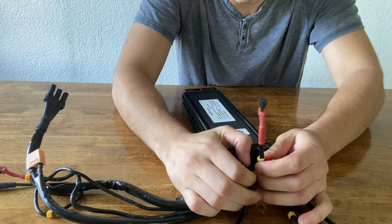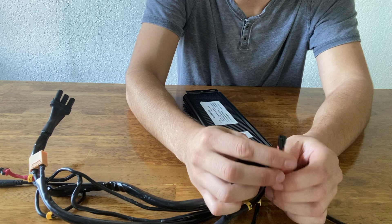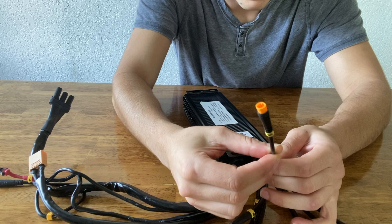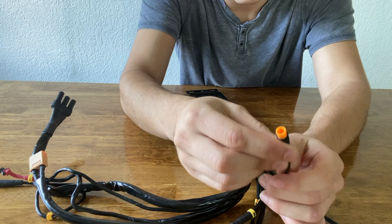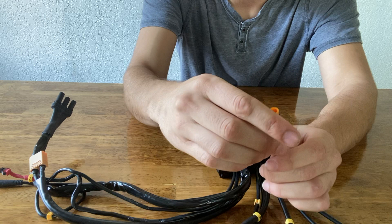This wire, almost always covered with red shrink wrap and a little stubby wire, is your on/off switch. You can plug this into a little on/off switch or use a little looper, because it's basically just an open connection that needs to be closed in order for the controller to turn on. The throttle wire is a 3-pin connection. In older controllers Hi-Power Cycles used, it was a JST-style connection, but we changed it over to a waterproof connection — that'll help if you get stuck in the rain and don't want your connections to get wet.